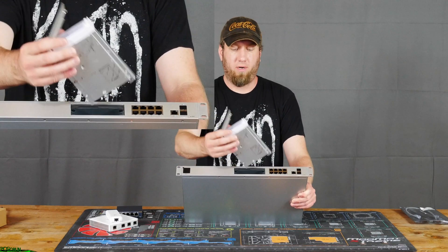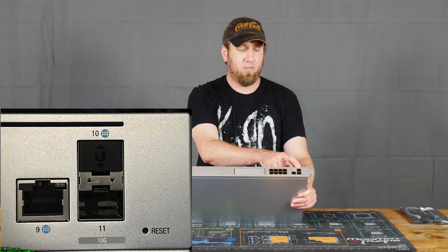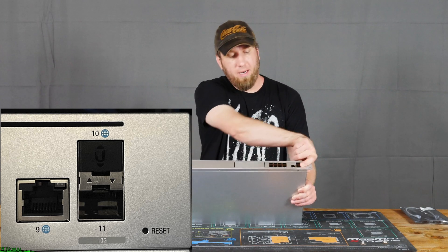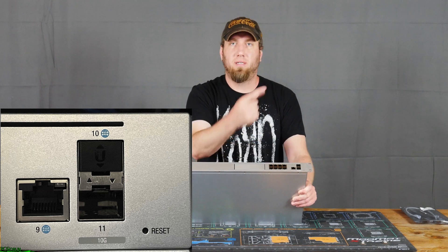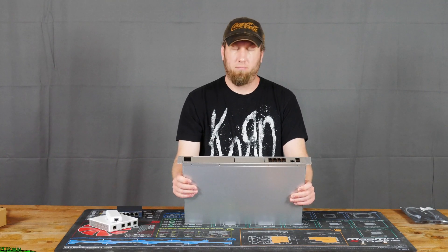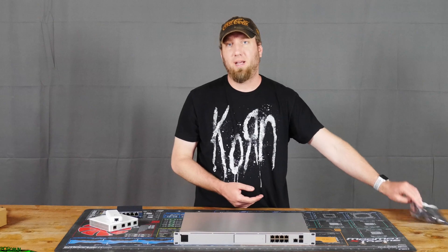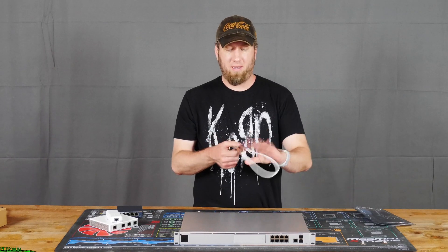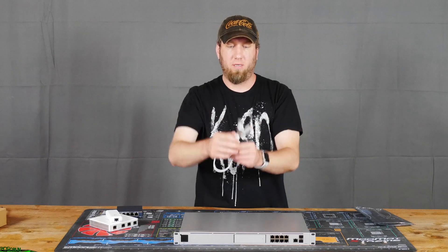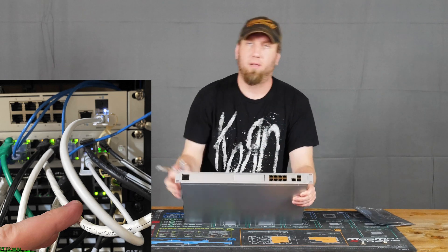It's got a spot for a hard drive that you can use for your UniFi camera system. It has a 10-gig WAN port, so this is where you'd plug in your 10-gig internet. And then your 1-gig port for your internet if that's what you've got — that's going to be where I'm plugging in my internet. This bottom port is another 10-gig port, so you can daisy-chain it down into another switch at 10-gig speeds. Honestly there should be two of them for redundancy, but you can use the gig ports as a backup. You've got to have a 10-gig cable with SFPs on it, and this is one of the Ubiquiti cables for this. I'll pull off this plastic, slide it in, and plug it into my other switch, and it's good to go.